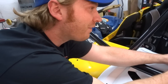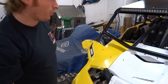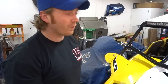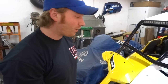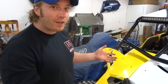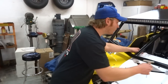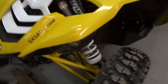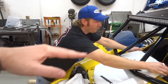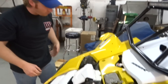I think the front on these is actually a little undersprung. The rears are really, really stiff on these - if you own one, you know, right? Those are way over-sprung. So the rear is definitely a little softer after the respring. The front supposedly is a little undersprung, so I'm interested in trying it out. Hopefully it balances the machine a little better. Maybe it jumps a little better - not that it jumps bad right now. The dual rates on the rear were a big help with the bucking. The front end kind of flopped on the Silver Lake jumps real bad - came down like a shitty bike. The front end bottomed out a lot easier than it should have.